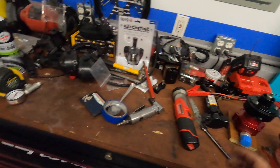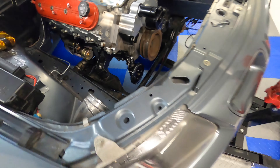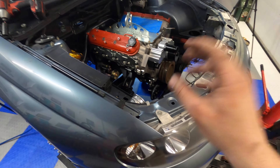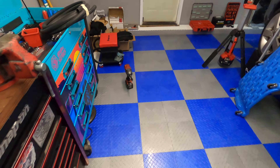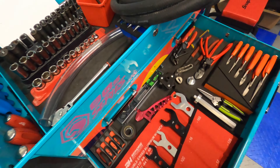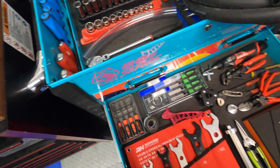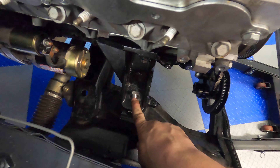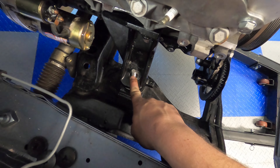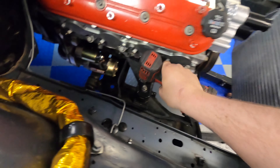We got our mechanical pump that we're going to be mounting in the rear, and here we have the front end accessory that we're going to be putting on. I went out and bought burrs for aluminum and modified the engine bracket just a little bit — you can see the stud is poked out about half an inch back. I gave a little bit more clearance to the rear end, and I left that off so I can show you guys. Go ahead and buzz that down.